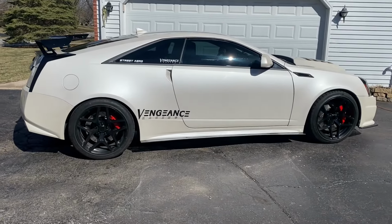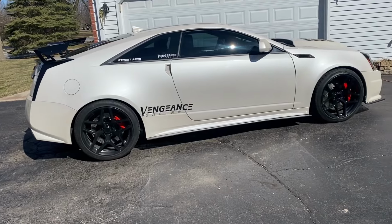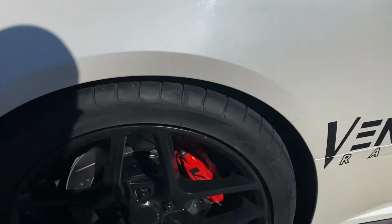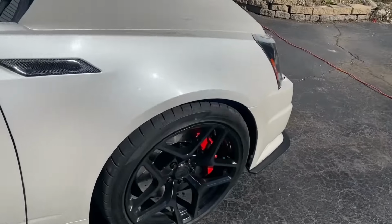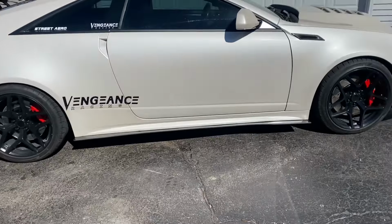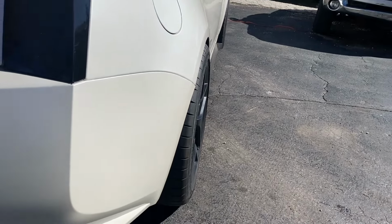All right, guys, so here's how it's looking the next morning. I've rolled it around for a little bit to help it settle a little quicker. As you can see, the rear end is really nice and low. I love that. Front end a little bit higher, based off the numbers too, but you can kind of visually see it. You really can't get a finger underneath from the back, but you can definitely get about a good finger in from the front. So I used to be able to get two fingers in back here, but now that's not happening. And I can barely get one finger in there. Now from the front, it's actually sitting a bit higher. I can almost get two fingers in, definitely one finger. I love the stance on that. And I'm sure as the days go by and that front settles a bit more, that stance will get a little better in the front. But that's pretty hot. Look at that, that's good. Nice and tight.